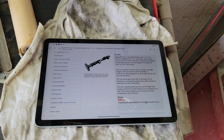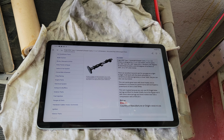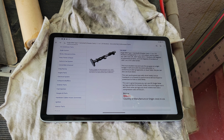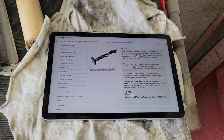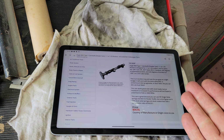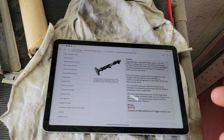It's fine. And that's in a bus, so you can run higher compression and still do it, but you just have to be aware that if you're pushing it too hard, you're going to get hot. Like when I was going out to the desert, I got it a little too hot, and then all my valves got tight, so that happens too. And that's because I have them all set at 0, since I have Chromoly push rods, so I can set it at 0. The heads got a little loose, had to tighten the heads, stuff like that happens when you get too hot. So if you don't want to mess with that, go a little bit lower in the compression, 8.5, even 8 3/4 still. It's still pretty well doable for the street. And with the performance cam, it just helps it fire that air and fuel that's in there.